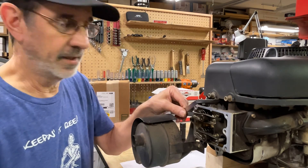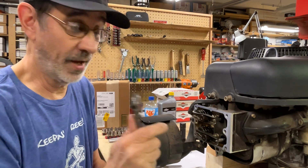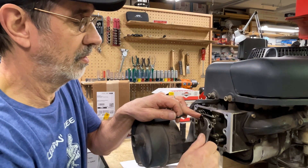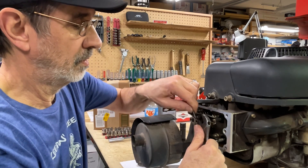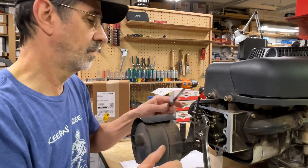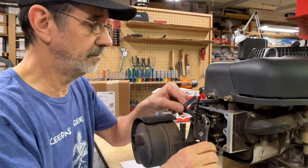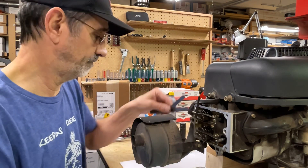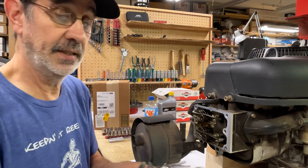You just want to get a little drag — that's all you need. Then the fun part is trying to get the wrench on there without turning that nut, because they turn very easily. That's not too bad, really. I got drag — you can feel it catching. So now we want to use this and lock it down good, and again, hold the nut.